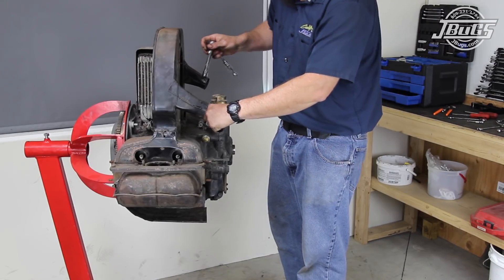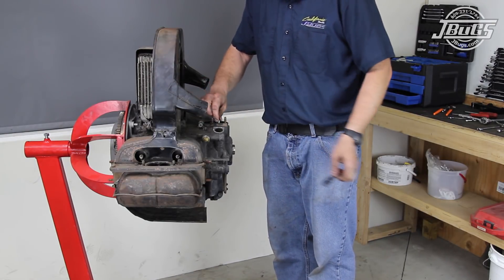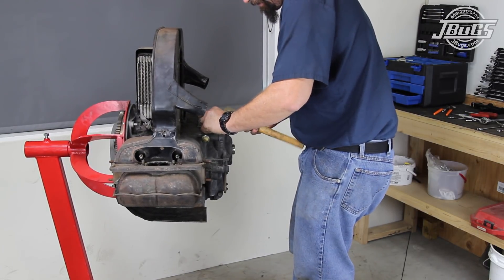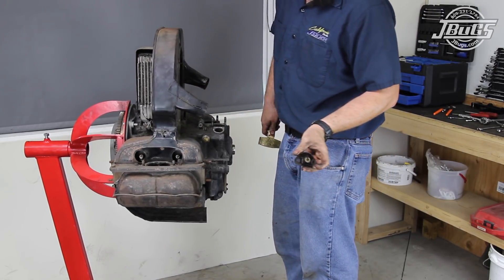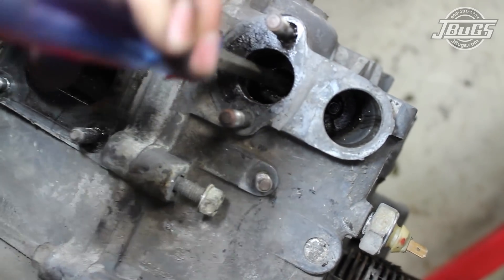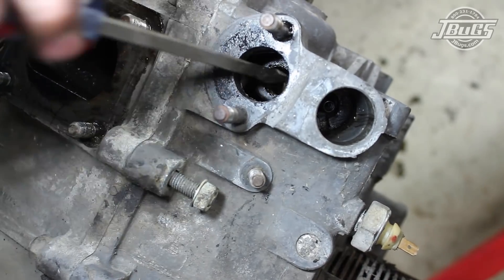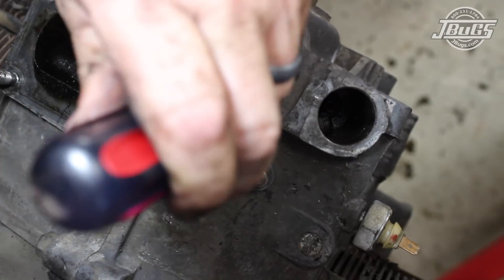The two nuts for the fuel pump are unthreaded so the fuel pump can be removed along with the fuel pump drive rod and the fuel pump flange. Our flange took a bit of persuasion with some light taps from a hammer, and when the flange did come free, it was in two pieces. The piece still inside the engine will be tapped out with a screwdriver, broken up inside the case and poured out by flipping the engine over. VW made the flange out of plastic so that if it did break, the smaller pieces inside the engine would be relatively harmless.